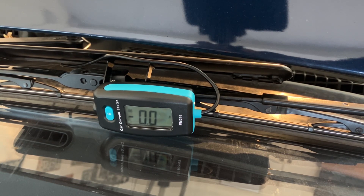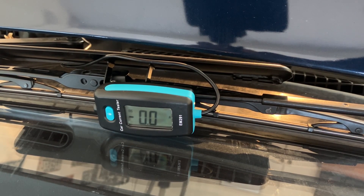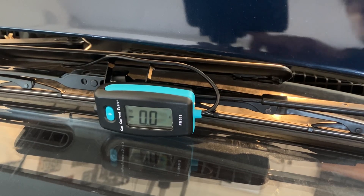In this case, there's plenty of margin — it's a good test to do. Some fuses cover multiple circuits, so just because it's doing the pop-up lights on this car, it might also be running heaters, stereos, wipers, or anything else. By doing this test on each circuit the fuse covers, you'll be able to diagnose which circuit is causing your fuse to blow. Hope that makes sense, and we'll see you in the next one.